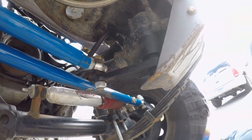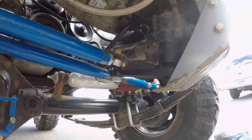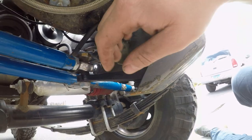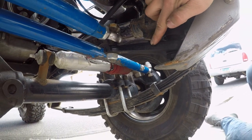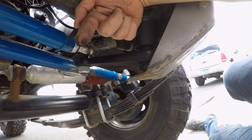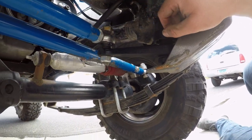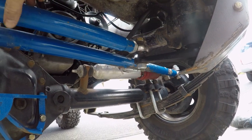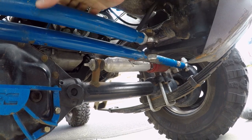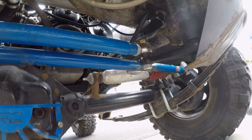This is my steering setup. Now most of the questions I get from everybody is, how did you do your steering? And that is a good question. This is a Jeep box. This is an Astrovan pitman arm, with a pitman arm that sticks straight down and wipes like that. And then an unnecessarily strong 7/8 heim with, I think it's a 1.5 inch by 1/4 wall DOM.